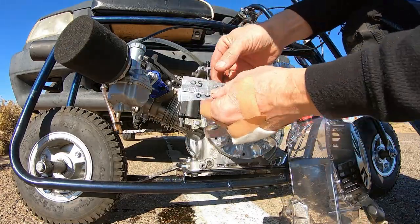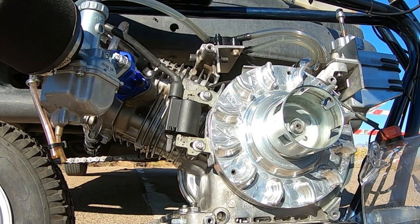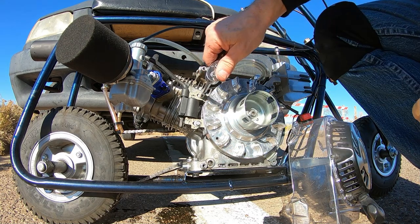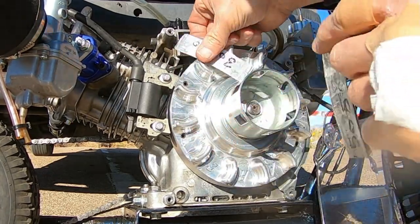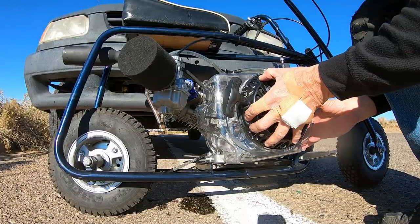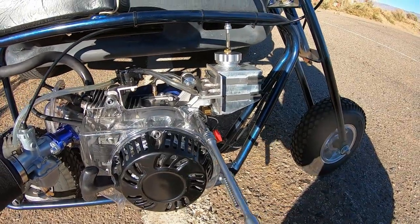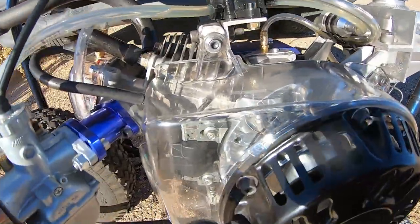I have both of my sleeves - a 50 thousandths sleeve and a 30 thousandths sleeve - for 80 thousandths total. There we go, 80 thousandths coil gap. I know nobody will run that kind of gap, but why not - let's just find out what it does. It'll be interesting to see if it'll even run with an 80 thousandths coil gap. Just don't know if it'll fire the plug good enough. Let's see if we can maintain 60 miles an hour with this gear ratio.